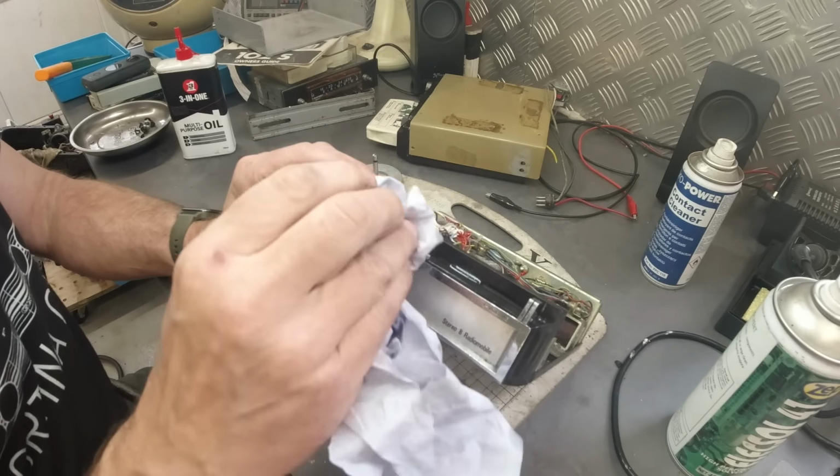You have to adjust the heads to make sure the tape plays correctly, that it sounds right and you don't get track bleed through, because on the tape, as again we've explained, the tape is in 4 tracks, total of 8 if you include left and right stereo. And if we look at this ABBA tape, the width of the tape contains all 4 of the tracks laid side by side. The left and right of each track are actually split. They're in a different location on the tape, not next to each other.